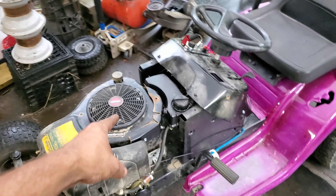The throttle on it is nothing special — just a regular generic ATV throttle. I drilled out one of these and five-minute epoxied it in to be able to clamp it down, and I put an independent choke on it. I'll post links in the description for this stuff. This right here is an ATV throttle sitting on a handlebar piece cut off at an angle so I could set it where I wanted it, and just like that — there's your gas pedal.